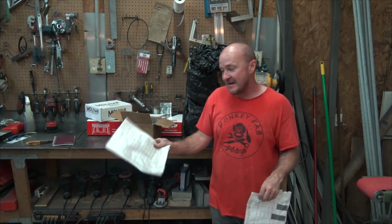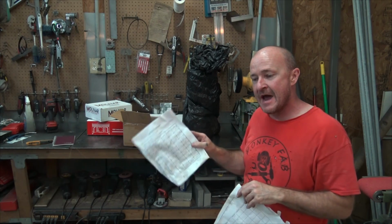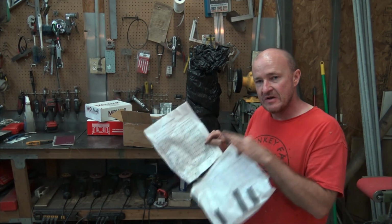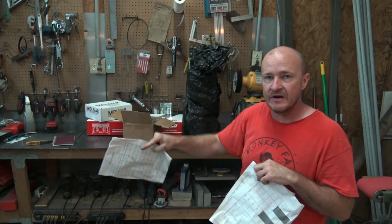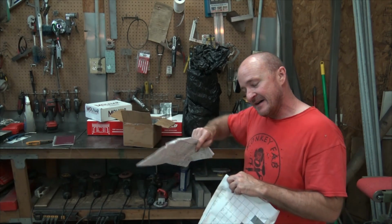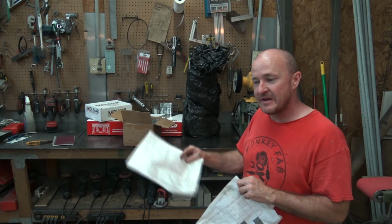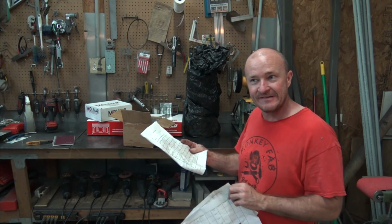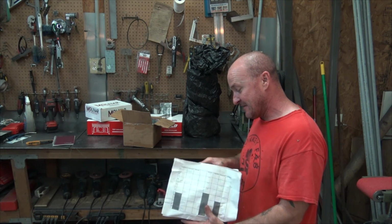It took quite a bit of line honing, so this is one sheet. Every grid on this sheet is a pass with the line hone. What you do is take the caps and sand maybe a thou or two off the bottom of the caps, then reinstall them on the bore, which makes the hole not round. Then you stick a big long mandrel with cutting stones on it and give it the old zoomy zoom, and then you guesstimate. You can adjust how much pressure you put on and how much you move it through. What you want is to get all the caps all the way through to be even, so that can be quite a chore. I've seen it done in 2 passes one time, but usually it takes me 10, 12. So this is probably 12 passes to get it line honed out, but it's line honed.